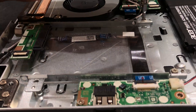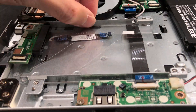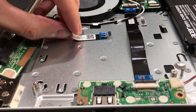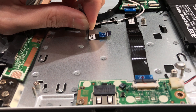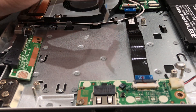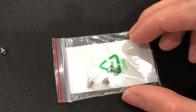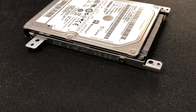For the 2.5-inch drive, I first unscrewed to remove the tray and the SATA header. This revealed the ribbon cable that is double-sided taped — I haven't seen one since my Lenovo laptop, which I killed 3 years ago. Acer already included a small bag containing hard drive screws, so I mounted this 8-year-old drive to the tray.